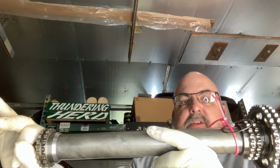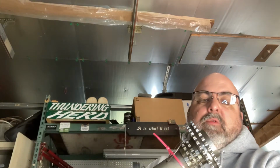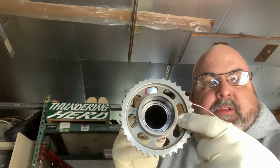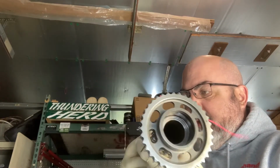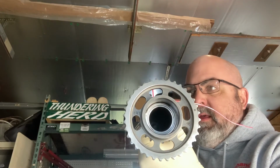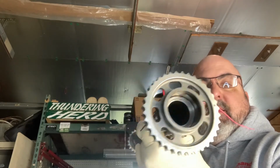So by taking the tension off of it, it allows it to remain a little bit more stable in the engine block. They do offer some set screws with the kit that go in, and I believe they actually catch on the webbing in between the holes. The problem I had with them is getting that to line up, and for the engine to remain at top dead center was a little bit of a challenge, so I went with the method that we're using today, which was to lock the camshafts and the crankshaft down and just hold everything relatively still and in place.